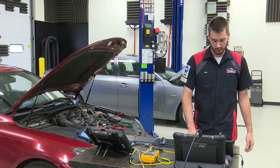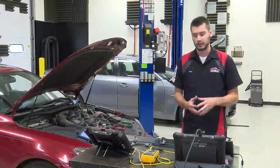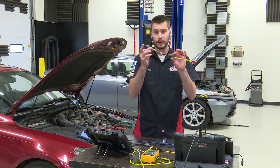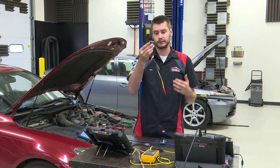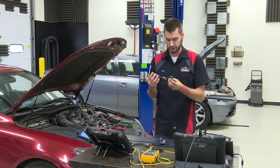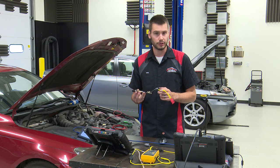The wideband allows us to stay longer in closed loop and responds much faster. This four-wire sensor — what we'll cover today on the Lexus — looks very similar to a normal oxygen sensor. It has two pins for the heater circuit and two for the signal circuit. It operates like a wideband but looks like a narrowband. It outputs a value directly related to the air fuel ratio. These sensors get tricky for diagnostics because we can't watch them as closely as a five-wire.